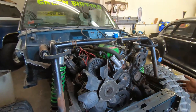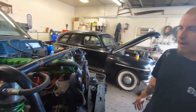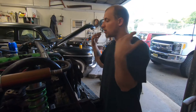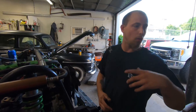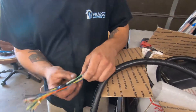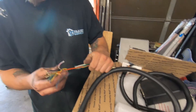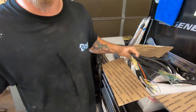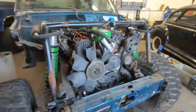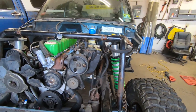We took the rad out just for now — it's going to stay here, we might upgrade to a better rad. Basically we have this thing stripped and ready to go, and I just want to start pigtailing in all the MegaSquirt wires. They're all labeled every foot, which makes it pretty easy. So we're going to hack into stuff — I know some stuff needs resistors but we'll figure that out as we go, and you get to enjoy the woes with us. Wiring harnesses are out, made ourselves a little more room, and in the next video you'll see us start patching everything together.